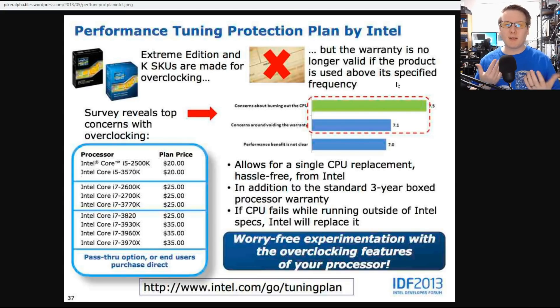A few people might ask: how does Intel know that you've overclocked the processor? These processors have fused bits such that if you go above the defined frequency in the firmware, those fused bits will trigger — a permanent indicator that the processor has at one point been overclocked. Intel can't really tell you how long you've been overclocking, but it can detect whether you've done any. And if you do any overclocking at any point, technically you're out of warranty.